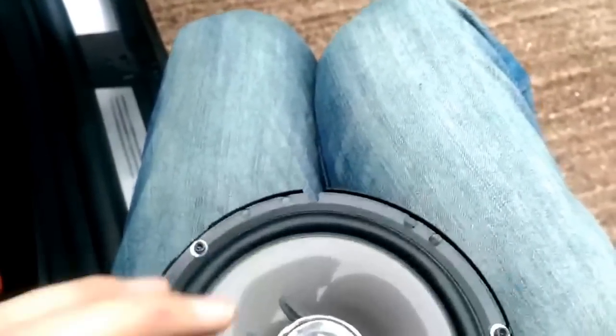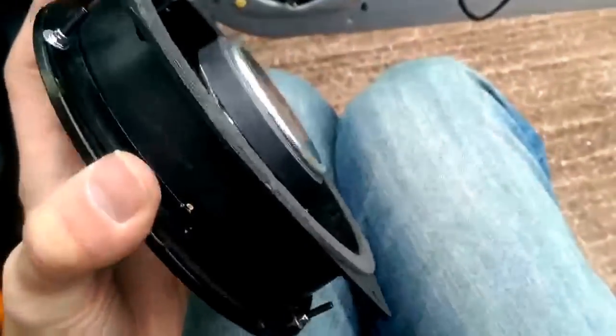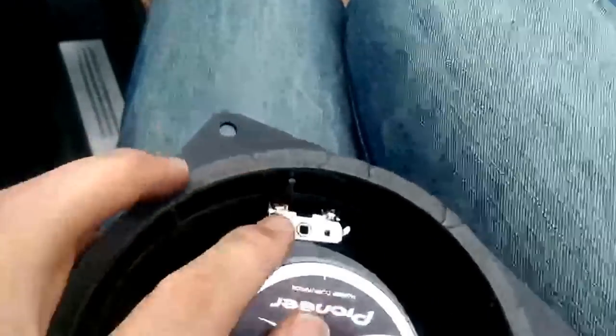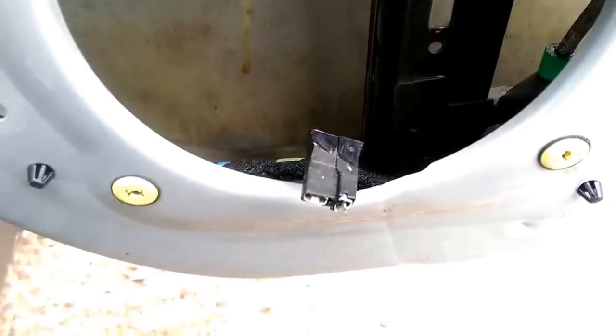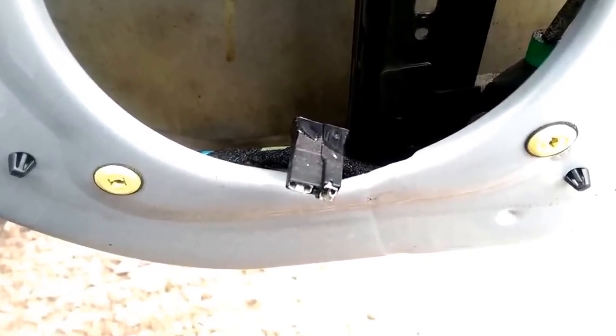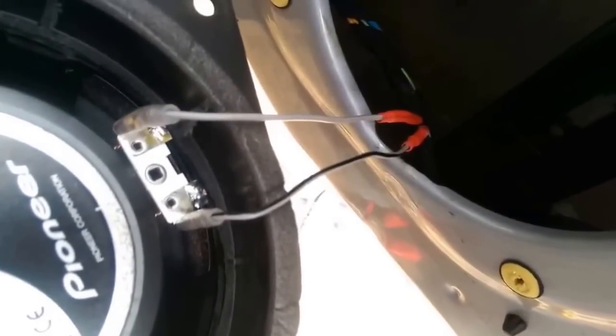There's the speaker with four bolts - I've managed to squeeze it in, and that was all I need to do really. I've put some more foam tape around the outside, and the last thing to do was to simply solder on new connectors that fit onto the speaker, as the stock ones won't work. The whole job was kind of 30 minutes really on each door. It's well worth it - I'd recommend it if you've got the time and feel confident doing it. I'd say it was one of the easiest jobs on a car to do. There were no problems and nothing broke for once, so thanks for watching - if you've got any comments or questions just please put them in below.